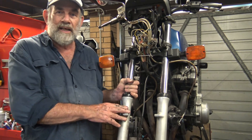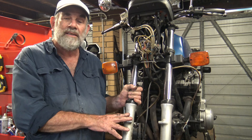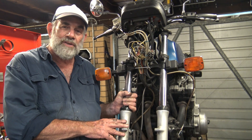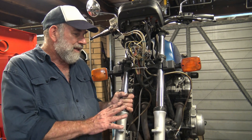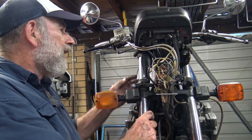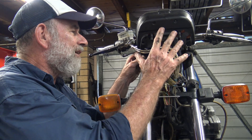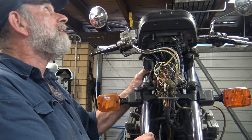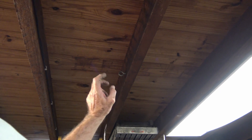The GSX forks are a little different to the Katana, particularly the 1980, 1981, and 1982 models — they are all similar. In the 1983 model they moved to a set of forks identical to the Katana with the anti-dive setup. Something a little different on these earlier models is that they have air-assist forks. It can also be handy, rather than undoing everything, to suspend the instrument cluster and handlebars above the bike using a conveniently placed eye bolt.